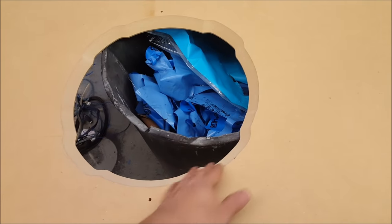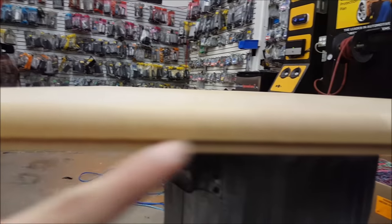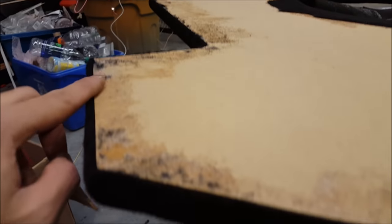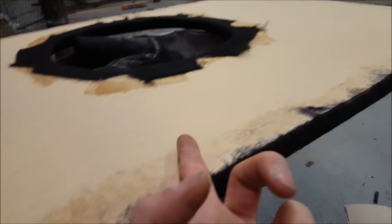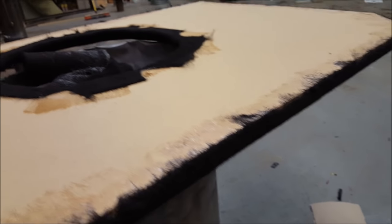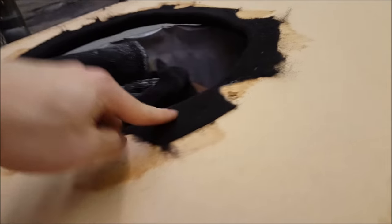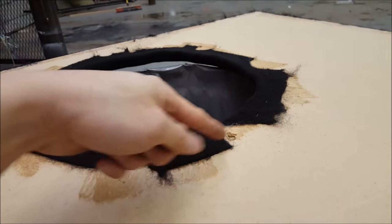I made a template of the TW12 and chamfered it to give it a 3D look. When carpeting, to make life easier I wrap it out over this edge so when I flip it over I just run my knife in here — that allows me to carpet it cleanly even though you won't see the other side; if you pull the panel out it just looks nicer. You can see what the cut line looks like if you rabbet it and run your knife along the edge. To me it looks cleaner, and if you want to take it one step further you could paint the back of it black so you'll barely notice the edge. I forgot to do it on one side, so you can see the difference between freehand and using the rabbet.